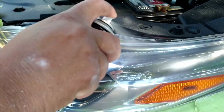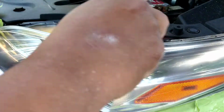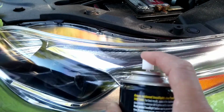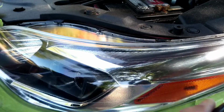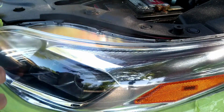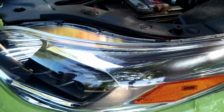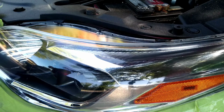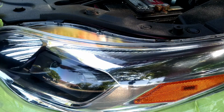This one is affordable. It has good longevity, and it is a true headlight spray for headlights, meaning that it does not damage the headlight whatsoever. It adheres extremely strong, or as strong as possible, without damaging the headlight. And it is removable. Once it hits a certain dry, cure part, you can remove this quite easily, way easier than what I just did now. And that's what you want. You want to keep in mind that you're going to have to take this stuff off to do a headlight restoration again someday. It could be 18 months, it could be 3-4 years, depends on how they take care of the vehicle and their patterns, and if it's a garage parker or if it's just sitting in the sun all day. It all depends, but you're going to have to redo it.